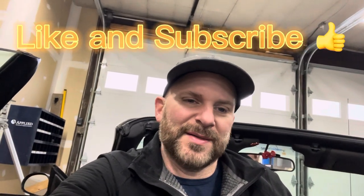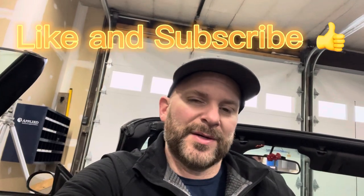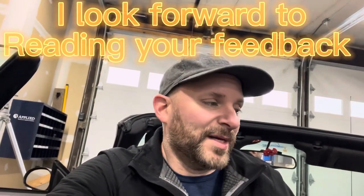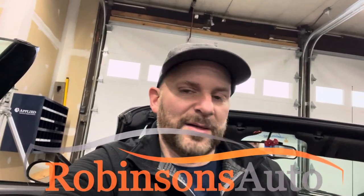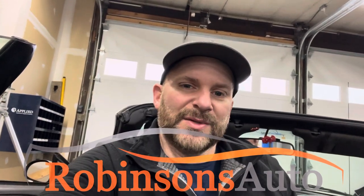Well, I'm going to keep this one short and sweet. I hope you guys enjoyed it. And what would you do? Would you just top it off with fluid, monitor it, maintain the level? Might be good for a while, might not be. But as you see, there's no major leaks. So my best assumption is that it's just been slowly leaking over time. So we topped it off as a courtesy, and I'll recommend some new cylinders. However, it's gonna be his call in the long run.